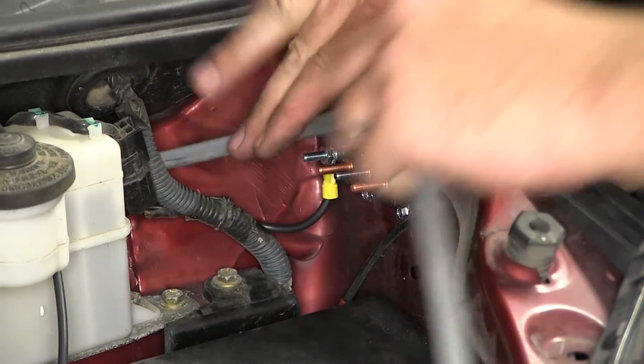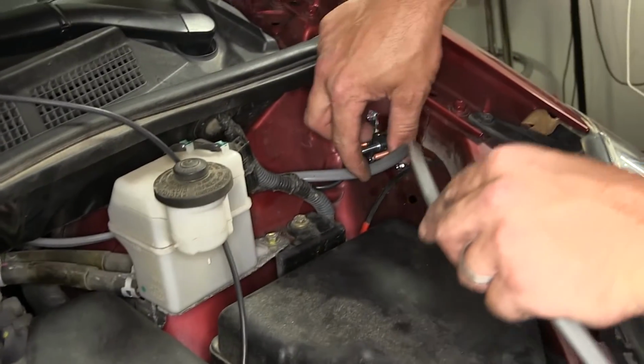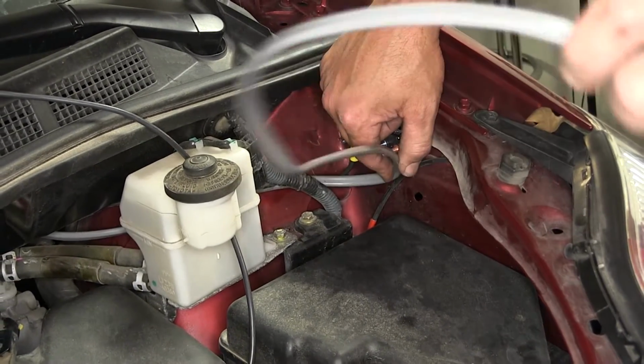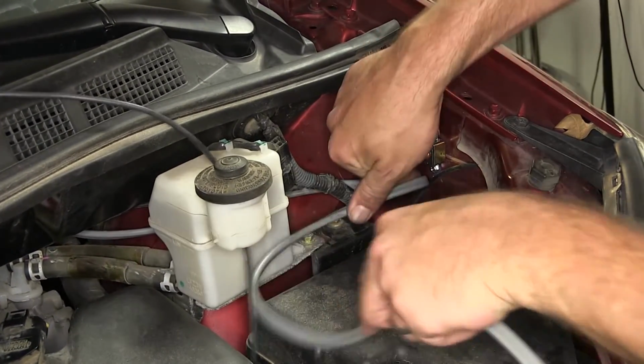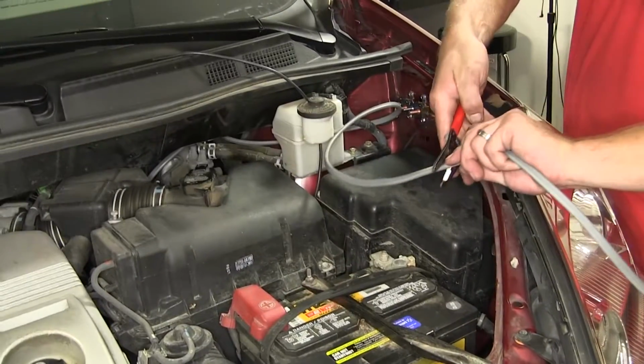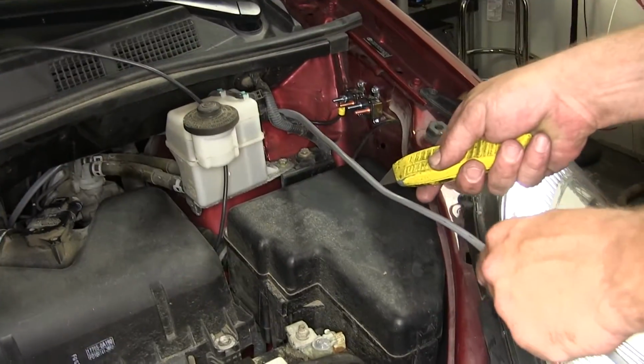Next, we'll take our gray duplex cable we routed into the cabin of the vehicle, mark it where it's going to need to be stripped back so that we can run the black wire to our breaker, and the white wire will ultimately get routed to the negative battery post. Here we can go ahead and cut off the excess wire and then begin stripping back the gray sheathing.